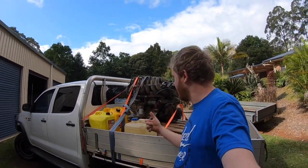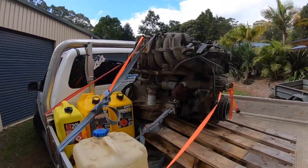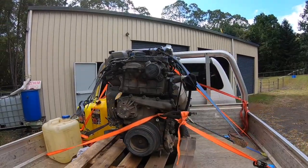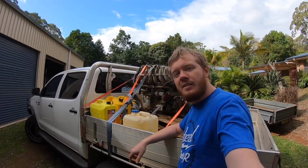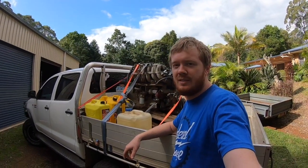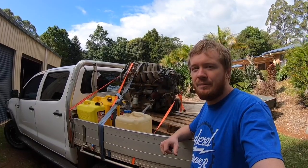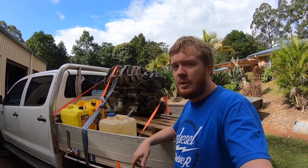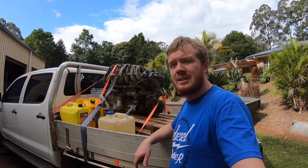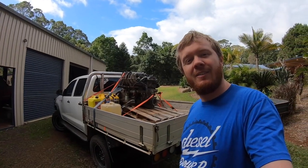Welcome back. This week we're going to show you our next project build, so if you like what you've been seeing and want to see more, please hit that subscribe button below and like and comment. So this is a TB48 out of a GU Patrol. We've got some E85 that's for another car, possibly on the cards for a later video. We'll be changing a few things on the TB48 — might make a custom intake manifold, and I don't know if I'm going to turbo it yet. But it'll have a custom wiring loom with probably a Link ECU running it, so we can hopefully get better fuel economy and tunability power-wise.